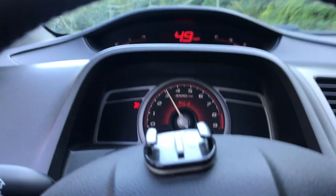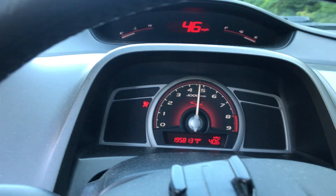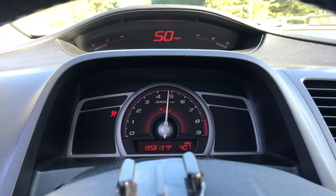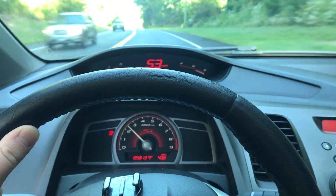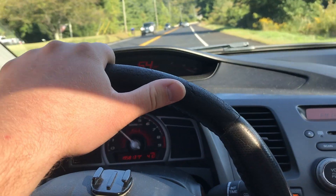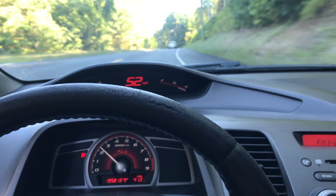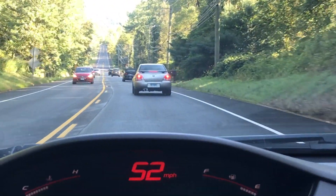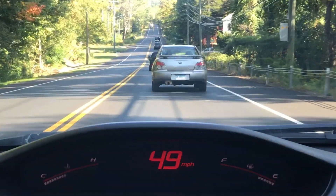It's a really fun tune. The only complaint I have is checking my air/fuels — you can see they bounce around like crazy, so it's not consistent like a regular tune. Nick even told me, 'Dude, you're burning a lot of fuel, just use it for fun,' and that's exactly what I'm using it for. Every time I just want to mess with people or feel fast, I'll bring out the crackle tune. In terms of negative effects, I'd say it's safe aside from maybe breaking down excess material in your muffler and exhaust system, but it's super fun. Now the Subie is about to get some side clips and roller shots so you guys can hear it from outside the car and see the flames, which are unreal.